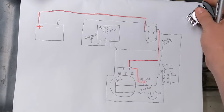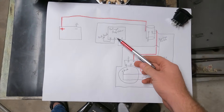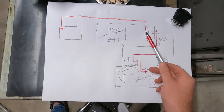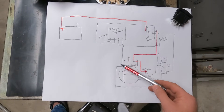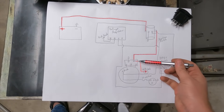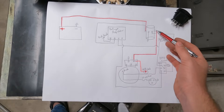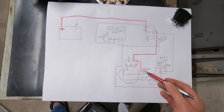When we push down on the switch, our ignition switch 12 volts is connected to our brush wire - so now it's unregulated 12 volts going to that brush, telling the electromagnets full magnetism, which gives us maximum voltage for welding. The final pin is just a ground that gives us indicator lights - you don't have to use that if you don't want to. On our external voltage regulator the A terminal goes basically to the battery, but I'm just going to wire it to the constant duty solenoid. The S goes to the ignition switch, the F or field goes to the bottom pin on our switch, and then here's our rectifier - the stator leads go into the three inputs, then the positive half goes to the other side of the constant duty solenoid, and this is going to be our welding lead where we plug in to weld.